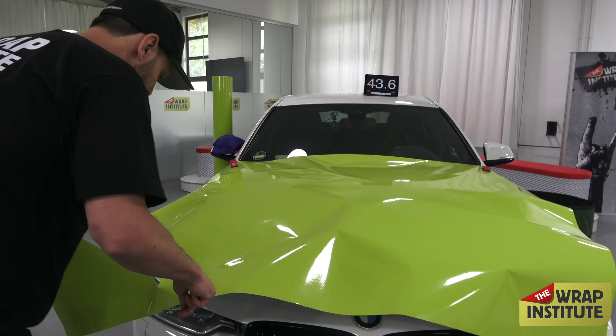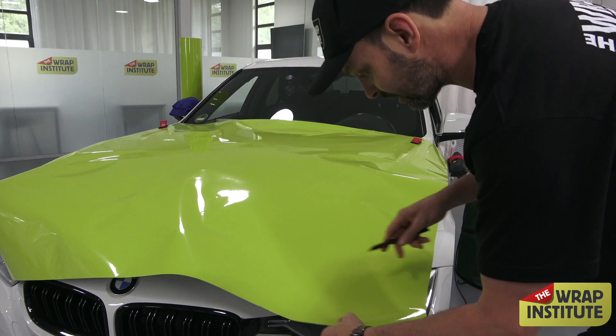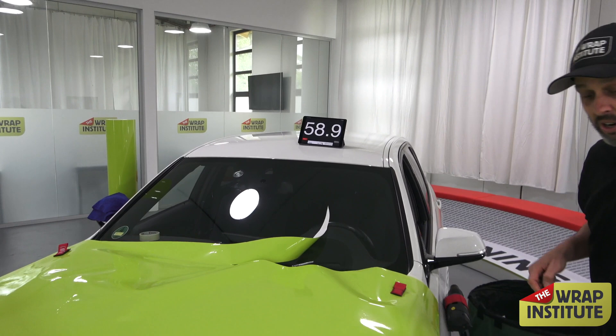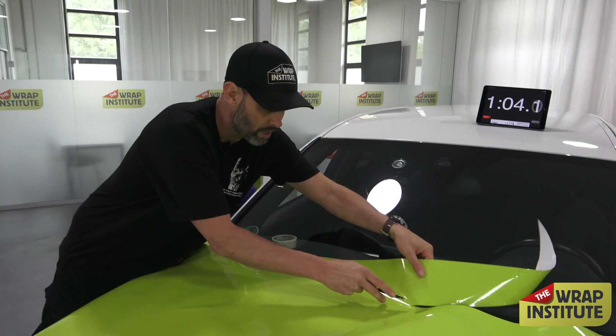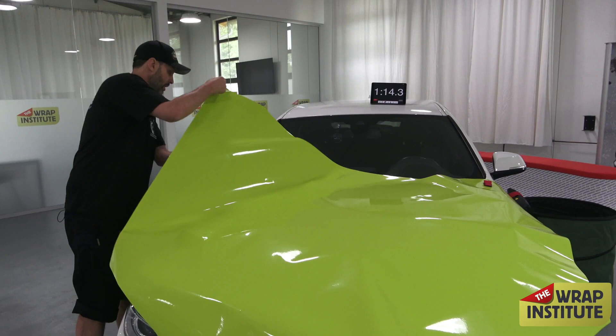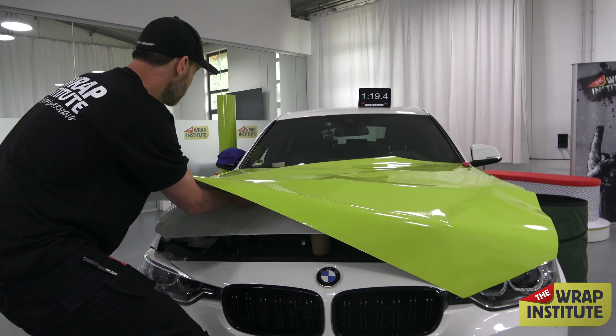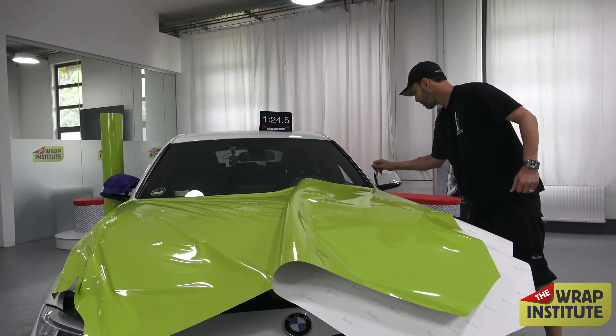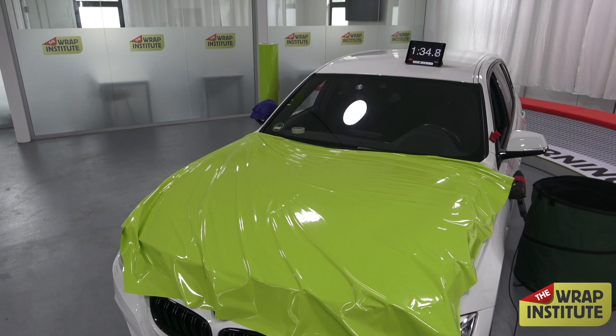The reason you want to cut away excess is scraps are money. In round two of the Never Stop Learning Contest, you're going to see Reiner wrap a mirror — if you save those scraps, you can use them to repurpose them on different parts of the car without using material from the roll, which saves money. But cutting away the excess material also makes the panel easier to install. So with the panel trimmed and ready, I'm going to release the liner, tack it here, and release the entire backing paper in one shot. I pull the backing paper away nice and slow, and set the material to the side.